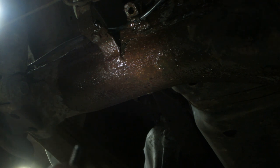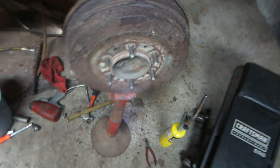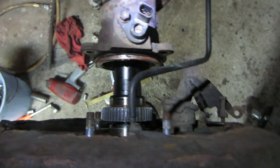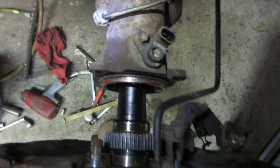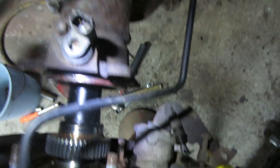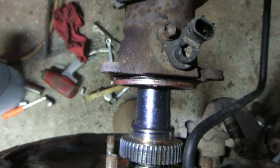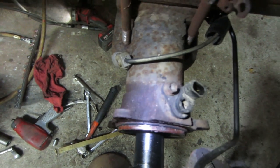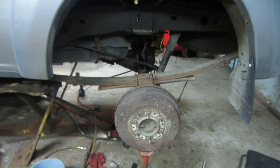I've got one or two more bolts to get on this side, then I'll start on both axles. One side's out — that's the ring for the ABS and here's the sensor. I had to heat those suckers; they're probably loctited from the factory plus crud. I'll do the other side now. It's sitting on a jack stand — I don't want whatever seal is out there to be hammered on.